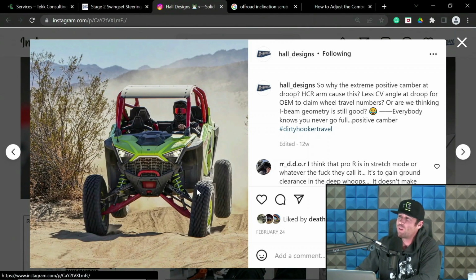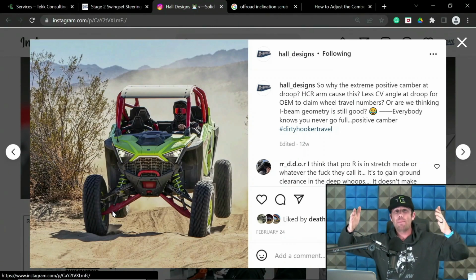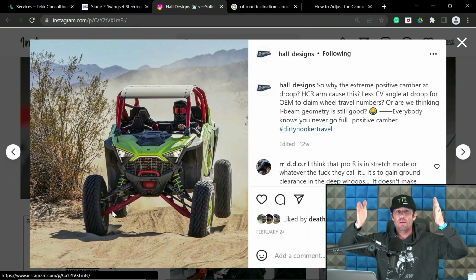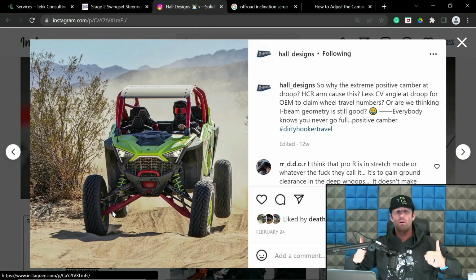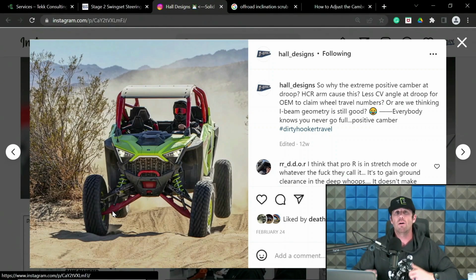I love it. So if you look closely, this car is toed in a decent amount at full extension. What happens is as the suspension goes into extension travel, the tires, instead of both pointing straight, start to point where they're toed in. That means the distance at the front of the tire is less than the distance at the rear of the tire. And this can cause it to be darty and kind of steer for itself to some degree, irrelevant of what you are putting into the steering wheel, hence the term bump steer.